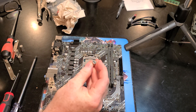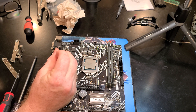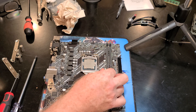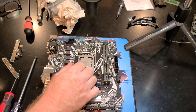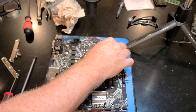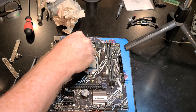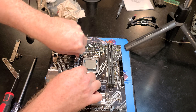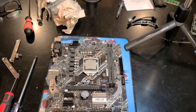This model has these spacers. The side that has graphite or rubber — whatever material it is — would be the side you want touching your motherboard. Screw those in, and hopefully don't catch your finger on the motherboard and drag it around. That's one of the problems with it — there are so many things your finger can get stuck on. So we're tightening this down.